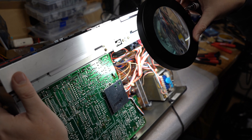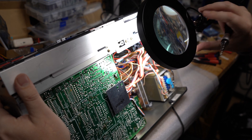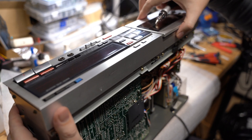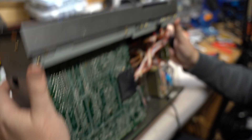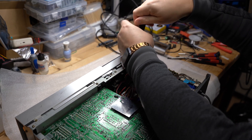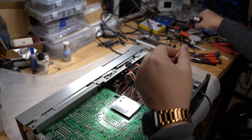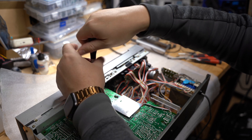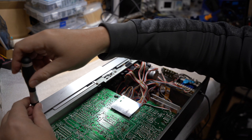First of all, I'd like to check if there is a gear which transfers power to the supply roller, or if there is a belt — a so-called tire. If it's a tire, we would need to replace it to improve the torque. If there is a gear, then we would need to disassemble the motor to see if we can restore it. In the worst case, we would need to replace the motor. I hope we would be able to avoid it.